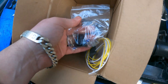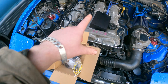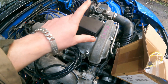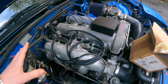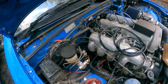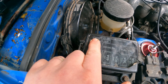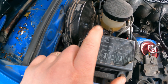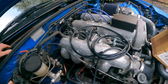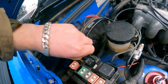In some kits this is already assembled — mine is not, as my kit is three years old, but if you order one now you might get a better kit. The installation should be exactly the same. One really important first step: this fuse here — the 10A — needs to be pulled, because it conflicts with the fuel management of the ECU and can end up ruining it.